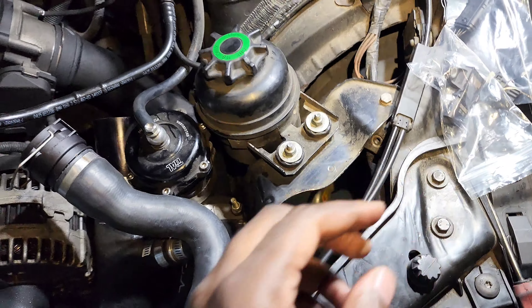Like I said before, they have an adapter that's pretty much plug-and-play. Once you take out the MAP sensor, there's a wire connected to it — just pull it out, plug this one in, plug that one in, and we're good. Then just plug the other end back in and that's pretty much it.